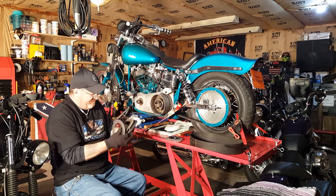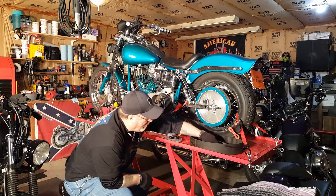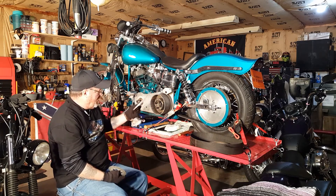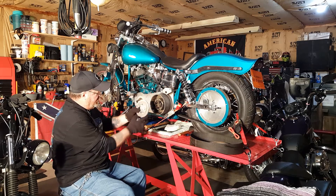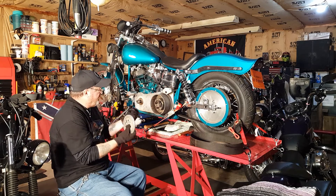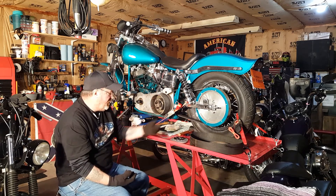This is obviously the last plate — it's the thickest spacer plate. These are all the clutch discs; they still look pretty good. And the spacers in between — this is a seven-count plate. What makes it really nice is this piece here. When it goes on, here are the nuts that hold it, then the pressure plate goes on, and then this goes on. You don't need any special tools — you can just sit there, undo them, and pull the whole clutch basket apart.